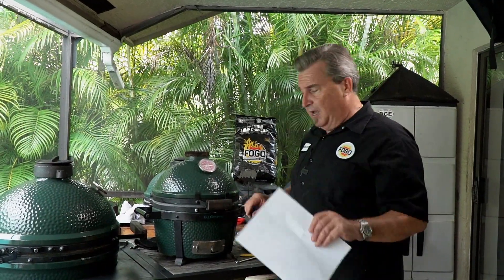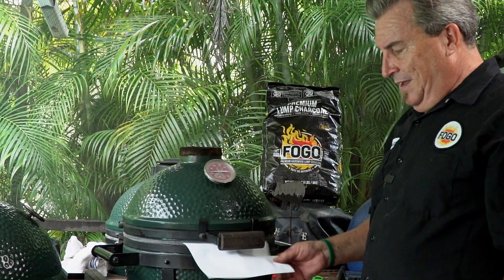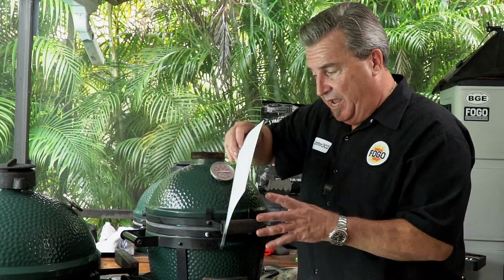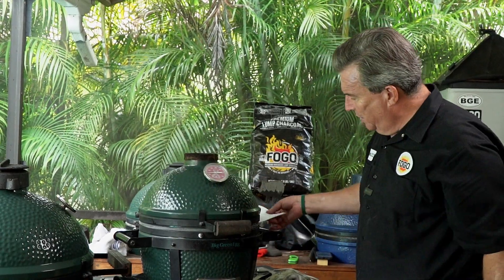There's one way to test if you did this correctly: take a piece of paper and stick it in between the dome and the base, then close it. There should be some tension — you should not be able to pull it out easily. Do this all the way around; you could even do it with a dollar bill. You can see there's tension — it's actually sealing. Same thing on all sides — it seals up perfectly. We did an exact perfect gasket change here. I don't think it took us a half an hour to do the whole thing, so it's really simple. If you're not sure if you can do it, trust me — try it out. We sell the gasket material; there's a link in the description below for whatever size egg that you have. Great adhesive — it's going to last you a while. Don't live without a gasket, folks. So that's my Minimax Big Green Egg gasket change — I hope you enjoyed it. Get out and grill, and I'll see you next time on The Fogo Life.